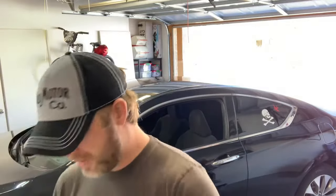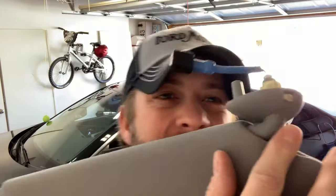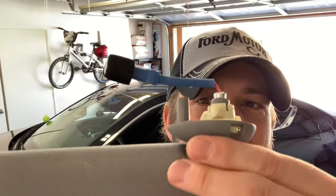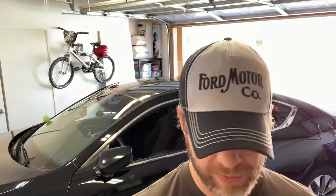Now what I have is a brand new from Honda sun visor right here. As you can see it is in the correct color. There are two options — there's a cashmere ivory and some weird gray color, which this is. I believe the cashmere is for the EX models. So what we're going to be doing is — inside right up here, how this thing is actually sitting inside the car — there's a little button right here, and it is actually a lock mechanism, and we're going to have to push that out inside the car to be able to pull this thing out. Let's get started on that.